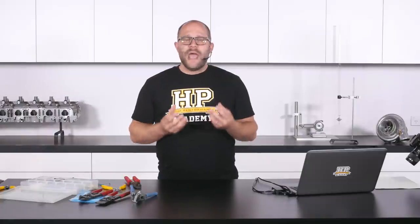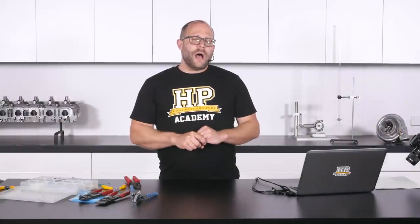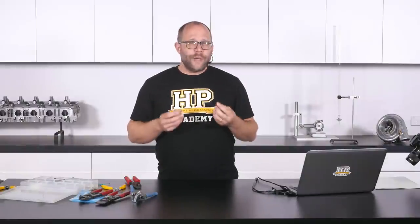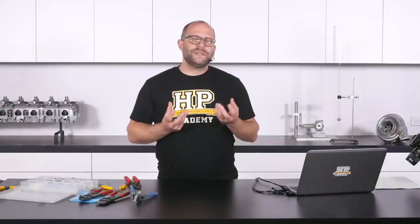Next we're going to talk about the actual type of splice we're going to use and how we're going to size it. If I'm building a wiring harness for a club level loom — I like to divide wiring harness projects into two categories: our club level or modified street car harness, and our professional level motorsport wiring harnesses. The club level harness is absolutely not a budget low quality harness — we're still using really good materials that are completely accurate for the situation and will be nice and reliable. However we do have to factor budget into that decision as well.